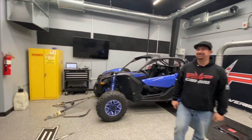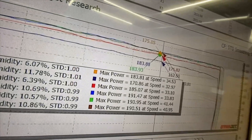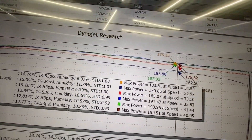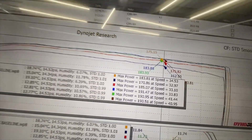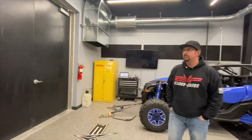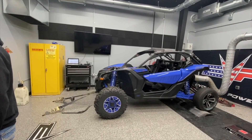What do you think? Well, there's some solid gains for different octane fuels, all stock injector. I think those are going to be great. A little bit of change on the wastegate for that high boost tune? Yep — just one pound of wastegate crack pressure. But I think these are all definitely pump gas, whether or not they're 91 or 93.